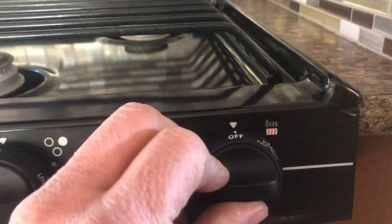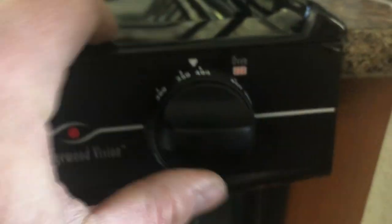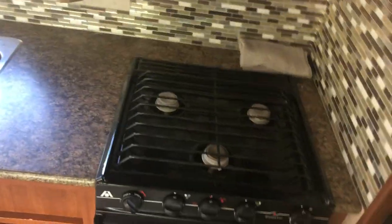The oven has a manual pilot light only — the strikers do not work on these pilot lights, which is a safety feature. To light it, you set it to pilot — it says push and hold — press and hold the knob, take a lighter to the back where the flame comes out, light it, and hold for a few moments until it runs nice, blue, and steady. Then release the button and set it to whatever temperature you like. Be aware these ovens are smaller than a regular oven, so make sure there's airflow around whatever you're cooking or it'll burn on the bottom.